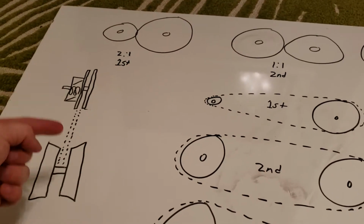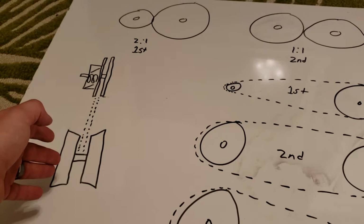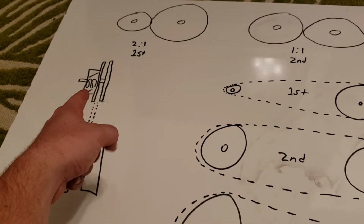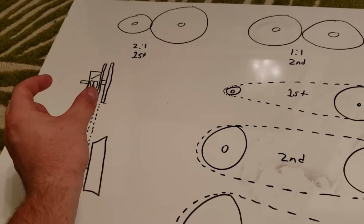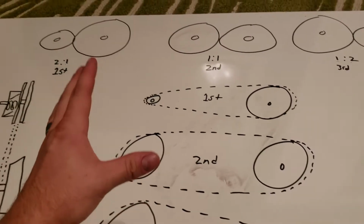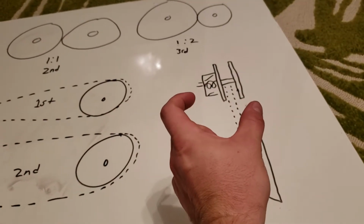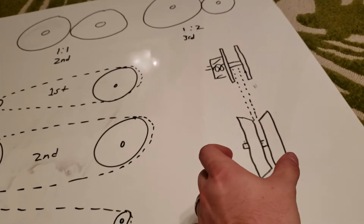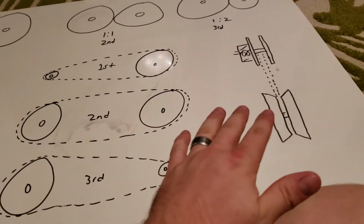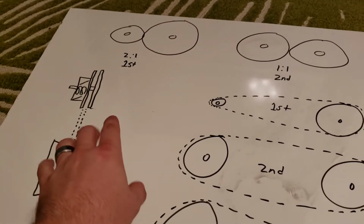With inertia and with the weight of the golf cart and the engine RPM, this spring is fighting the force spreading it apart. And as you gain speed and load on the golf cart, it will eventually widen. And the pulley up front will contract, but we're going to be worrying about the rear pulley. That is where the torque spring goes in.